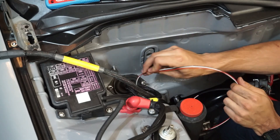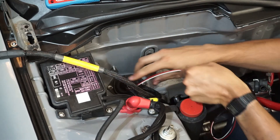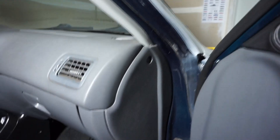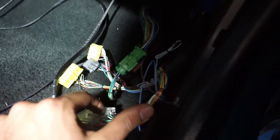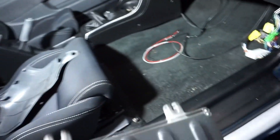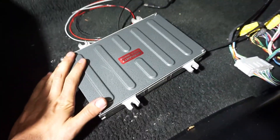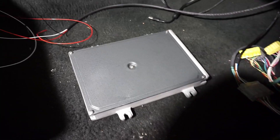I'll just take the ends of the wires here, fishing them down the grommet with all these other cables that are going to my ECU. So now we can go inside the car — here are our wires right here. Go ahead and pull our ECU out of there. Got the ECU. So let's pop this cover off — just one, two, three, four, five Phillips head screws. Voila.